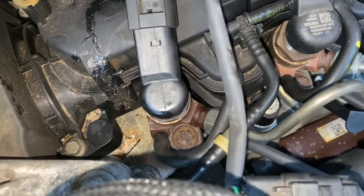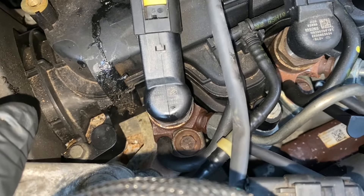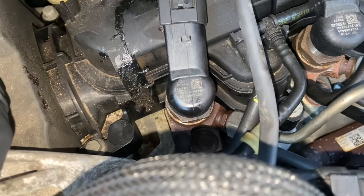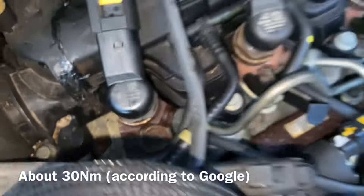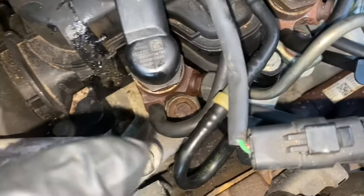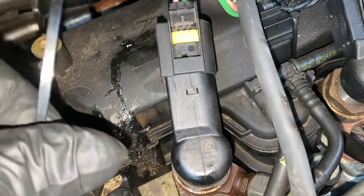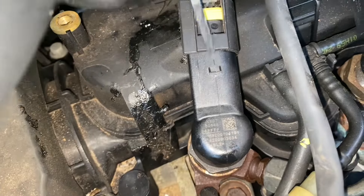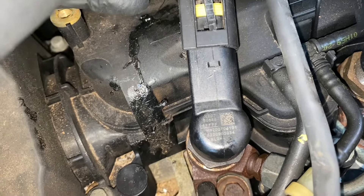As you can see that fits beautifully, and unlike the other one - if I could have got the other one to fit it could have burnt on the piston. So fitting the right one is probably the right way to go anyway. It's torqued down to specification. The high pressure fuel pipe is on, the low pressure fuel pipe and the return is on. But this plug is damaged, so I'm just going to try and work around that.